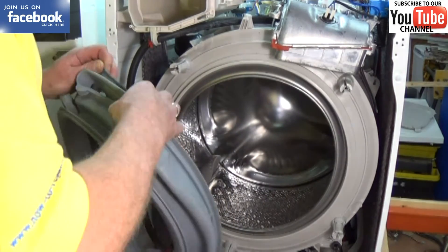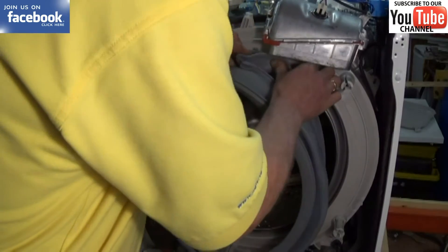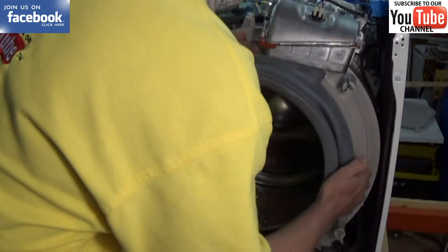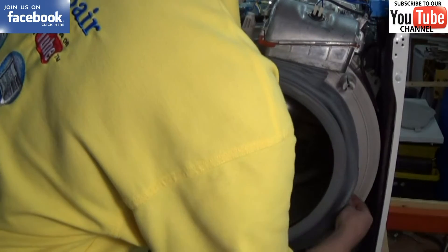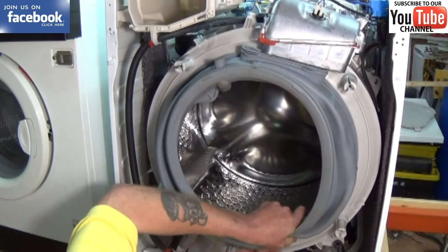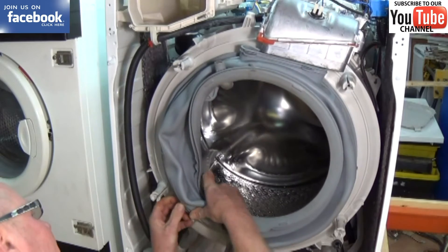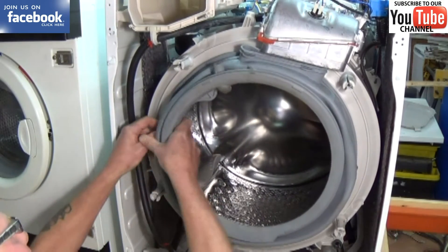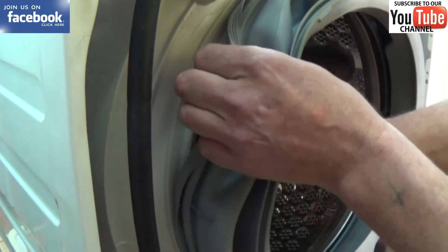The mark at the top here needs to line up with the mark on the seal, which I just showed you. It's very important that you get this lined up. The seal itself actually goes over the lip on the drum — just take your time and work the seal all the way around. Now the reason why the mark at the top of the seal has to line up with the drum is that at the bottom of the seal you have drainage holes that let the water flow back into the drum so it doesn't trap into the seal area. The second reason is the heater unit must line up correctly with the ducting at the top.